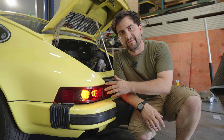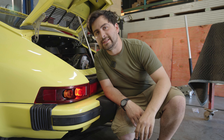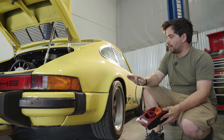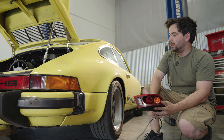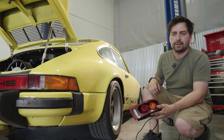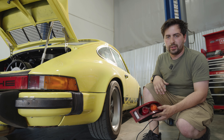Now that we have this side installed we went ahead and turned the lights on to give them a full test. Now you're going to do the same install on the other side. On the passenger side of these cars, some are equipped with an oil level sender. It's going to be located right about here and it's going to need two spade connectors that we have provided in the bag.